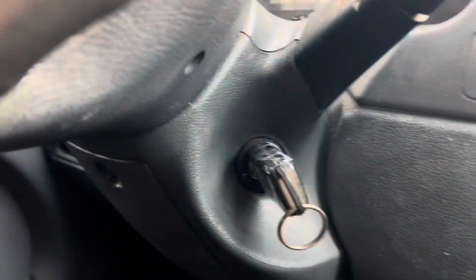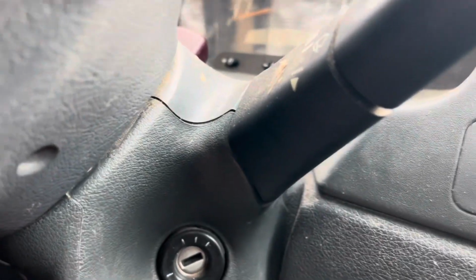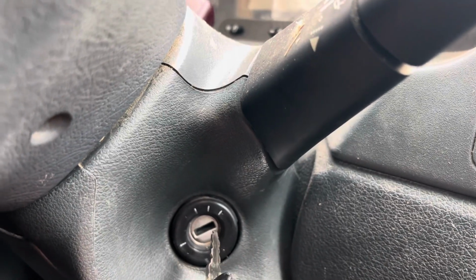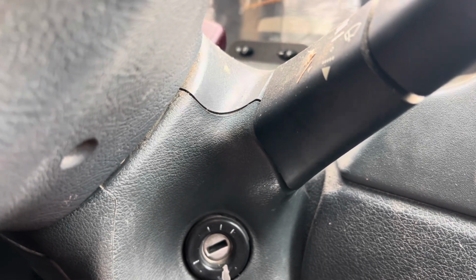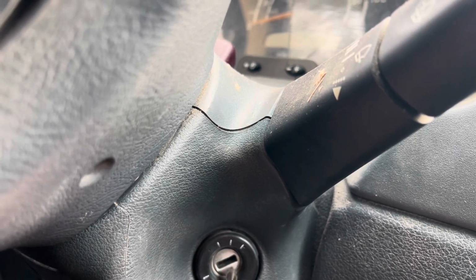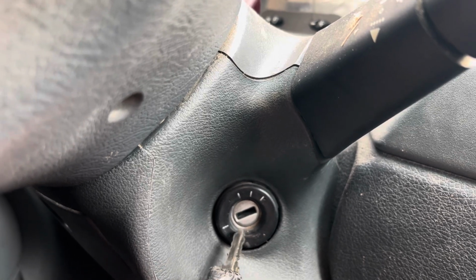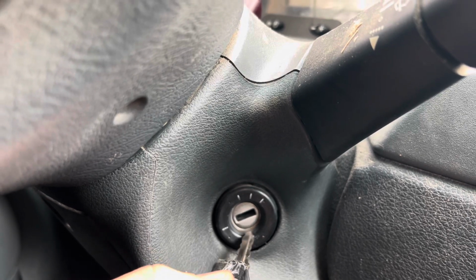And part of the reason is over here behind this key. Well, first I'll tell you this plastic thing right here. This is an antenna. It picks up the signal from your key, then takes it up to the immobilizer and then tells the computer, hey, everything's okay. And then you're cleared. But what you don't know is that in this ignition tumbler here, which is a metal part, in the back of it, you have the electronics that plug in. So the actual electronic ignition switch plugs in the back. That electronic ignition switch can be simply turned by a screwdriver.